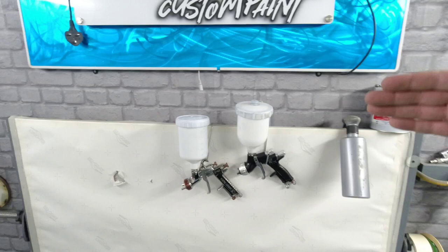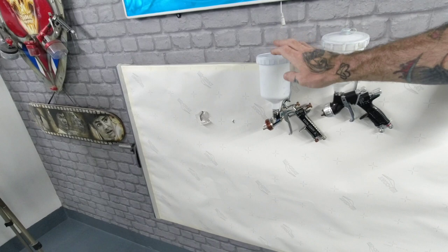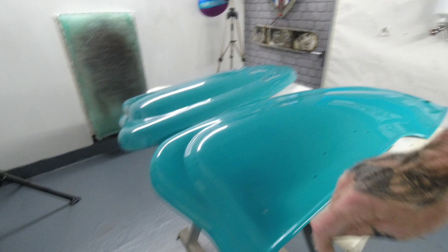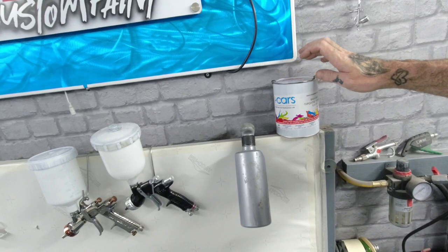The bits that we're going to be using today, spray guns, which will probably be in tomorrow's episode, GTI Pro Light with the TE10 cap for the base coat, and we'll use the W400 for the clear coat. For dropping a little bit of the epoxy down just to seal some of the metal edges off, we're going to use the Krios PS290 airbrush. Nice brush for that. You've got the spot cap so you can just drop a nice little intricate piece in. We've got the base coat, which is a colour matched to the bike.